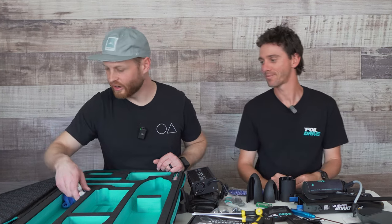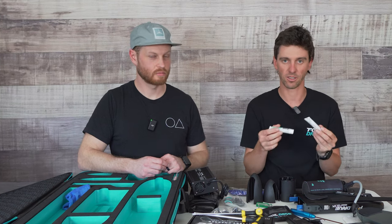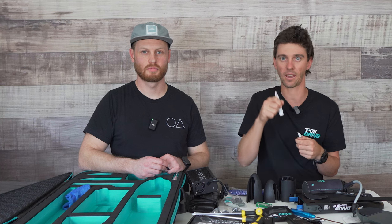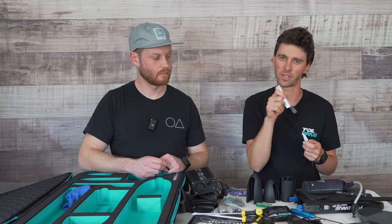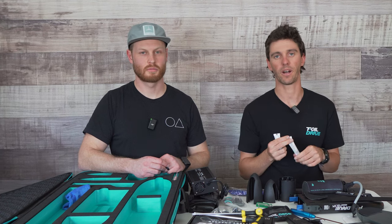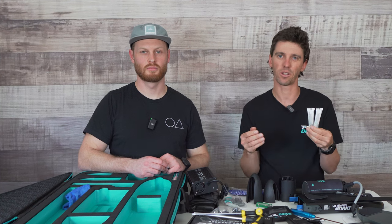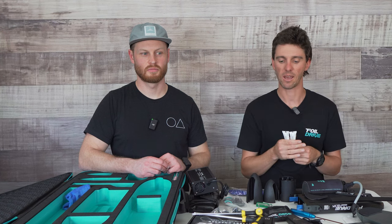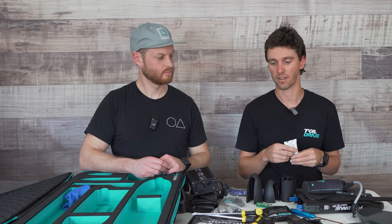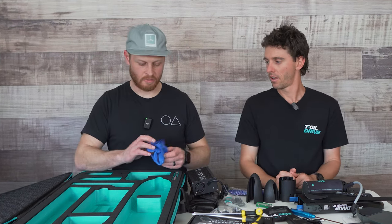Only a couple of things left — we've got two little tubes of battery grease. This is a special grease used for electronics; it helps lubricate and protect your battery plug. Before you use your battery, put a little bit on the plugs as well as your motor plug at the rear on those little gold pins — it still conducts electricity but it's not going to short out, and it puts a nice film layer over those metal parts that are prone to corrosion in salt water. If you do get them dirty or sandy, clean them out with a Q-tip or a little bit of tissue, then reapply. You can also use it as a lubricant for O-rings.